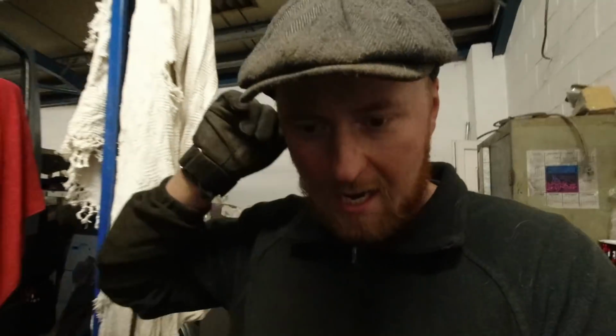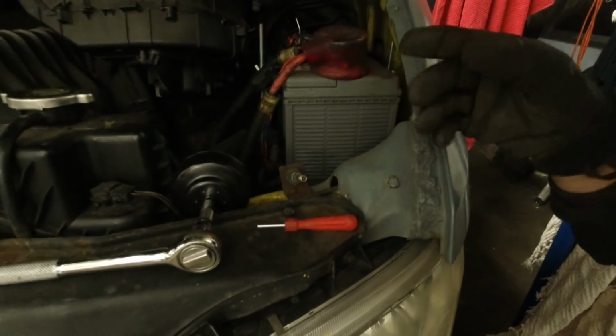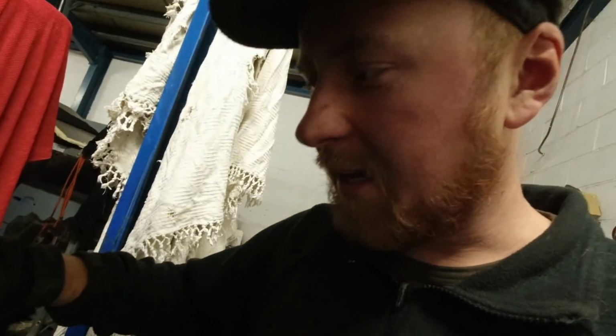However, bear in mind I've had this van 3 years. Never been able to find the leak. Get past the compressor, never been able to find the leak. I went through underneath the entire system. I got some water and Fairy Liquid and sprayed every single joint. Couldn't find the issue. But I've just come to here after going through everything again today, and it's only when you put your ear right next to it that you can hear the tiniest of hisses.